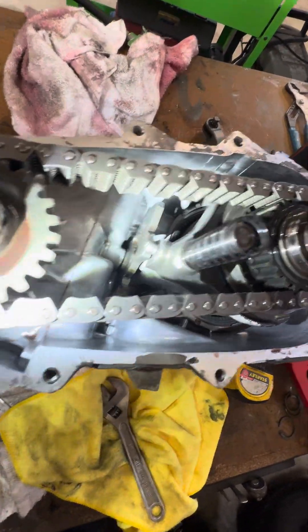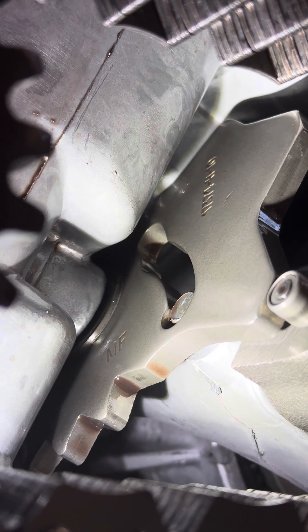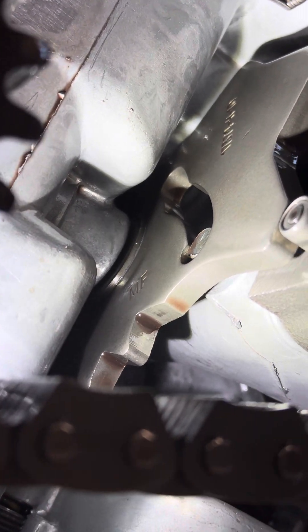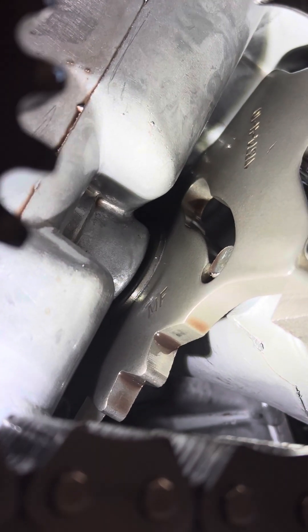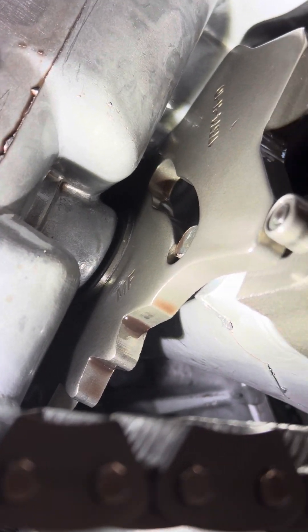This one's got the top half off and you'll see right there, down on that plate, you've got those numbers and the letters MF. Those letters MF, I've found they can be stamped in any orientation, but they look to be consistently in that area. So when it's in 4 low, you want them right there.